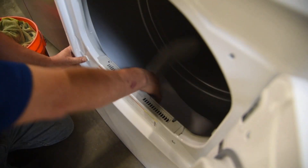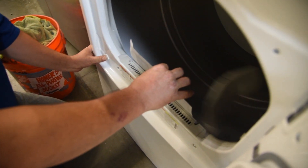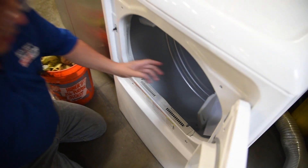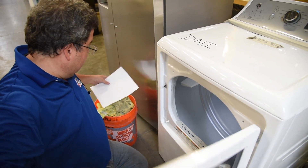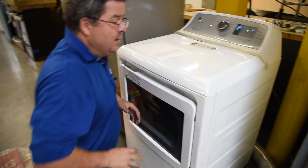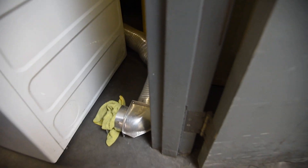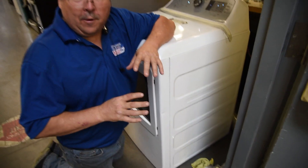See that? It won't hold it. I don't have air flow right now. I've actually sabotaged this unit so I can show you this. Everybody knows what this is — this is the tube that comes out of the back of your dryer that goes into your house. I clogged that so I could actually stop the air flow. Your house may have a clog somewhere else.